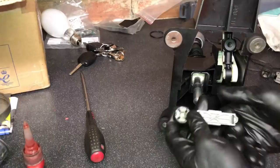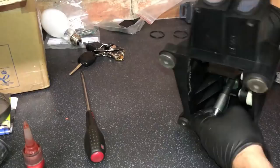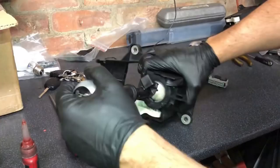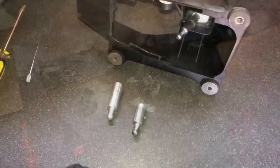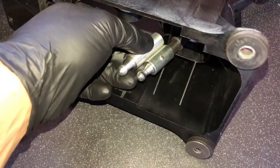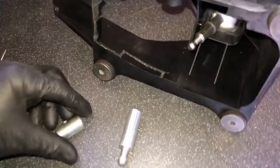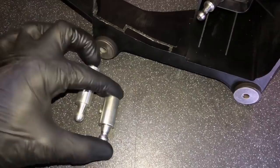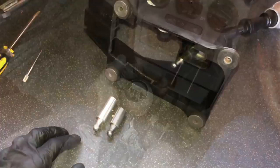Last but not least, get your ball joint — it's all nice and clean — put some grease in it and clip that back over like that. Good job done. All back together — you can see there's absolutely no play in the gear stick at all, solid and direct, exactly how you want it. We've got the new extended short shifter — this is the RD one. You can see how the new one is longer and how that extends the fulcrum point, which should improve shifting even more and shorten down the throw. The shorter the throw the better, and with the gear stick raiser at a perfect height it makes the car really enjoyable to drive. This one's aluminium and the new one is stainless.